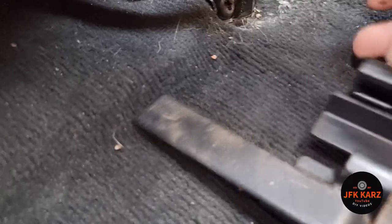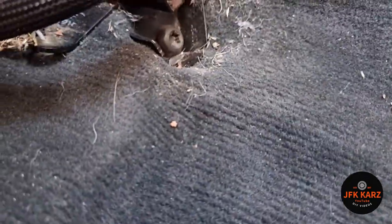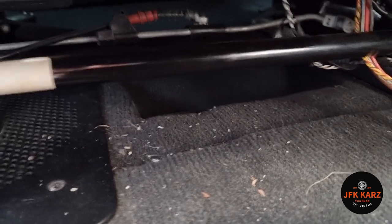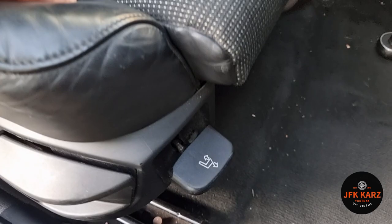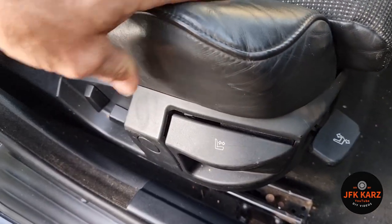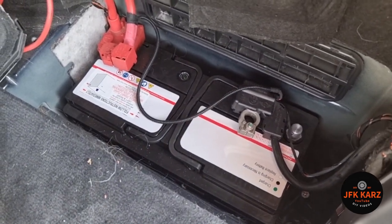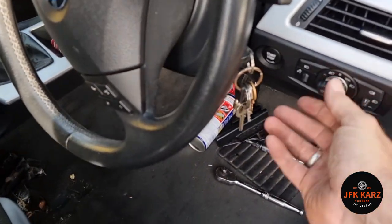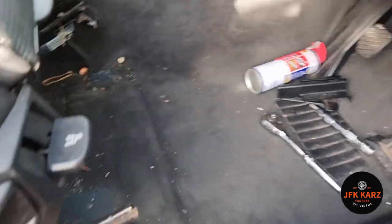Now I've got better access to this one, and then this piece of plastic just pull forward to reveal the other bolt just there. Then we can get access to the connections and I can hopefully see the state at the bottom of the seat. Before I go any further in removing the seat — obviously the bolts are out and I've got electrical connectors underneath — I'm going to disconnect the battery. So I've disconnected the negative of the battery. Now just turn your lights on or something to drain the last little bit out of there so there's no power.